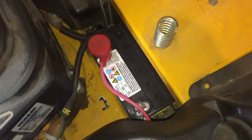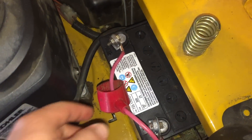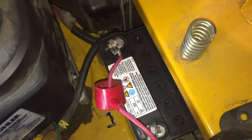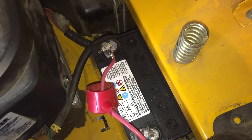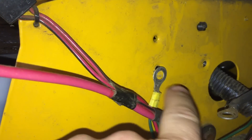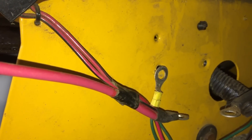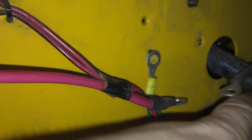Before removing any electrical components on your mower, it's always best to remove the positive battery terminal — just take your bolt off, move it away, and put the cap back over so there's no way to get any charge going through the mower and shock yourself. In order to make removing the solenoid easier, I loosened the screw going into the front end of the shield so I can lift it up and pull it away from the mower — that gives a lot more room to work with. On my mower, the top screws on the ground plate were 10 millimeters and the nuts on the posts were 11 millimeters. Remove the solenoid, remove all the nuts, and then remove the wire from the spade.